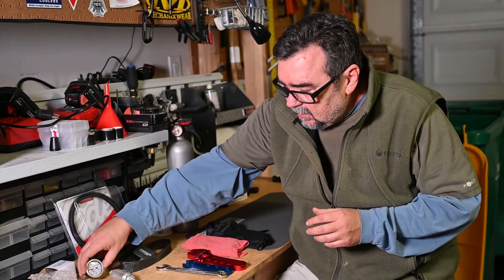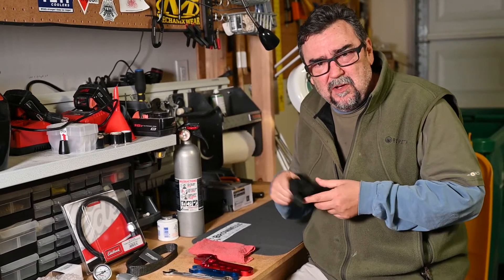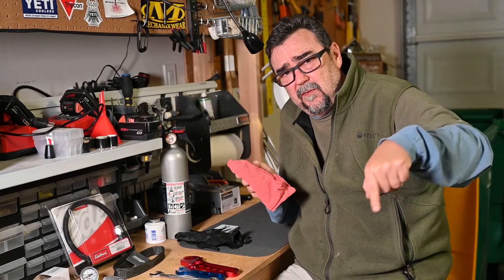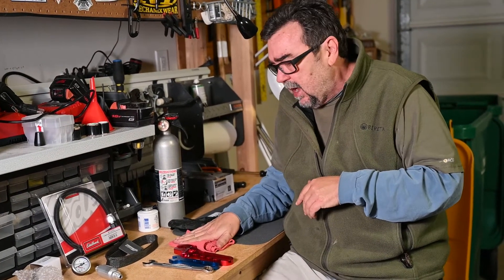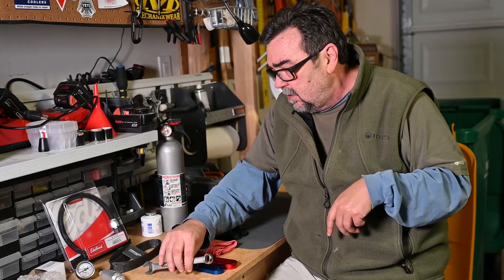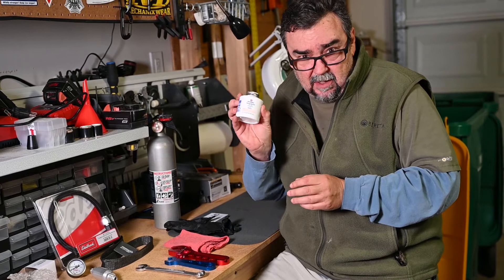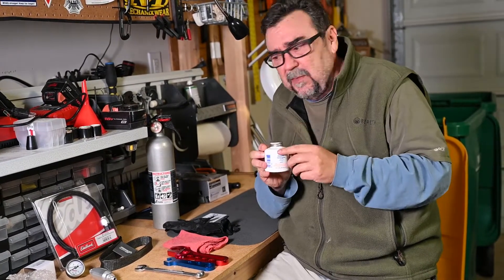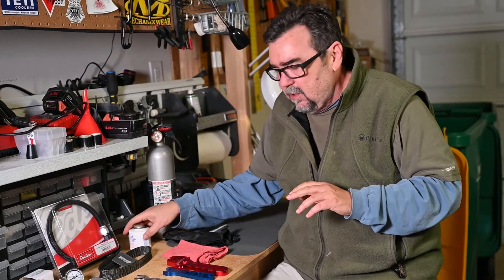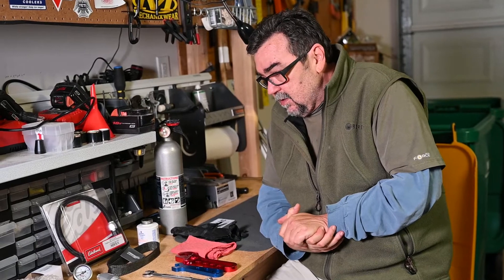To do this job, think about safety. We're going to be working with gasoline, so have a fire extinguisher and eye protection. We're going to use nitrile gloves because we're working with chemicals. Have a rag to put under the fuel line — when you take that hose off the fuel pump there will be some gasoline leak out. Have something to catch that. It's a good idea to use AN wrenches. The fitting currently on there is 5/8 — I already know that one.